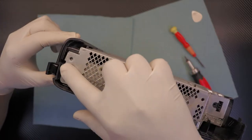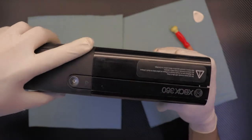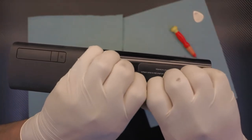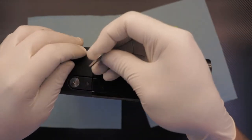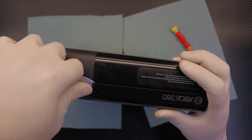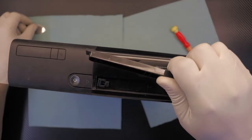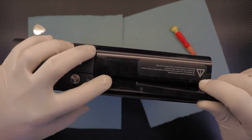Make sure here — don't pull this one; just put it in between the tiniest cover. Once you do that, don't yank it up or you're going to break it. Just hold it and go to the side. If it's not coming up, use your guitar pick — put it in between the eject button and this one, then twist it and it will come out.